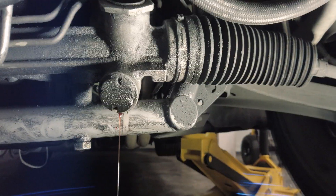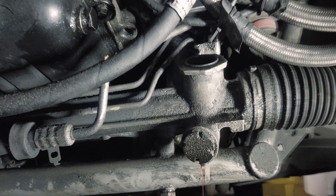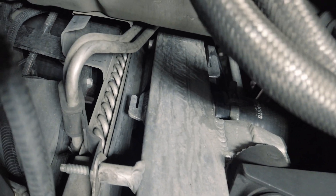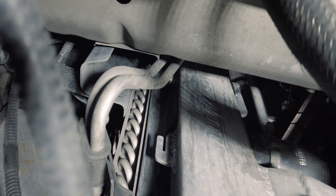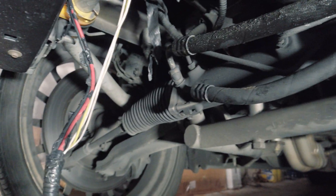I disconnected one of the lines off of the steering rack and I'm letting it slowly drain — there's a lot of tightness in there. As you can see, there are four lines connected in here; this is all just disgusting because it's been leaking. There's a line that goes in here and comes all the way back, and then there's a line that goes in between the radiator, and there's another line which I'm probably just gonna leave in for now until I replace the heat exchanger, otherwise I'll be sitting here all day. So we're gonna take the reservoir out, take all the lines as much as I can, let it all drain, and then disconnect the steering rack.